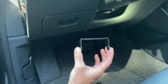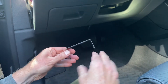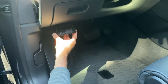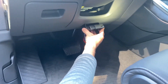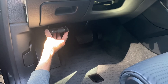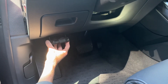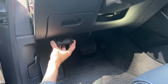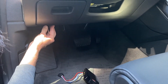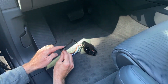The next thing may make you a bit nervous — we will actually need to drill some holes into the dash. Depending on where you want your trailer brake controller mounted, my personal preference is to have it just under here. Some people will like it under the steering column or off to the right-hand side, but based on my experience this location is best because you don't knock it when you get in and out of the vehicle, and you can also activate it in an emergency. It's real simple — just drill two small pilot holes. I've actually already pre-drilled them here.